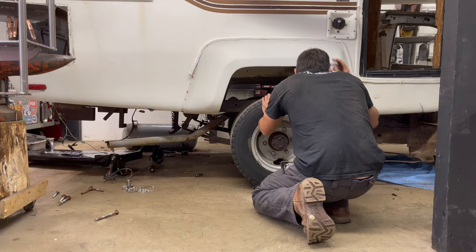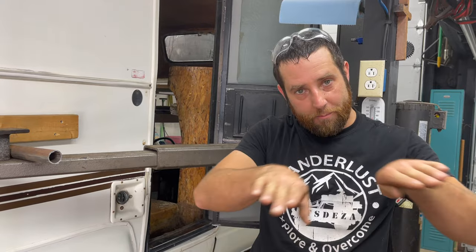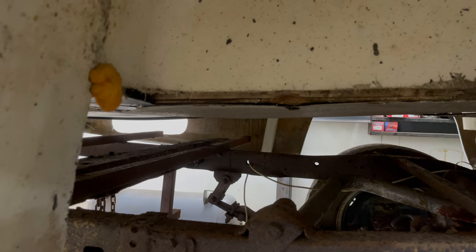Oh, the fuel filler neck. I have to unhook the fuel filler neck, and if you look under there, you can see the floor bowing. Clearly, it's literally just plywood with a little bit of insulation sandwiched between it on 3/4 by 2 strips and some steel flashing. These are not built like you think they're built.